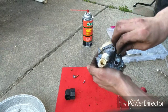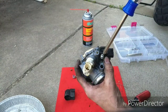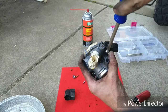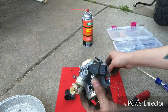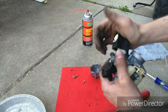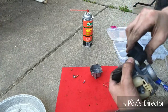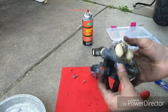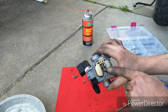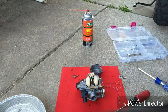That's back on; you can put the cover back on later. Let's get the throttle sensor on — put it on like that and then turn it until the screw will go in. Now we are essentially back to the point where if you were just taking this apart to rejet it, you would have pulled the two jets. We'll replace these two jets with something else. I'm going to go find the right jets for the intake I want to use.